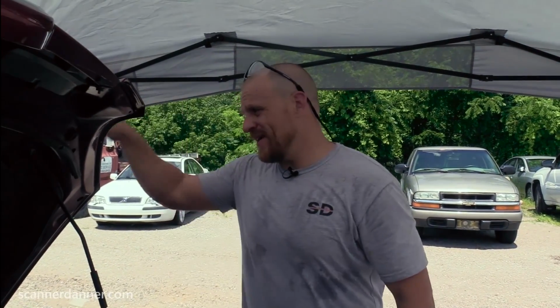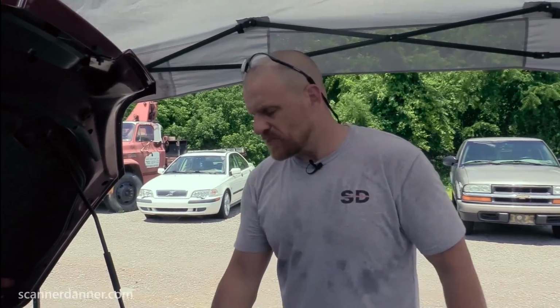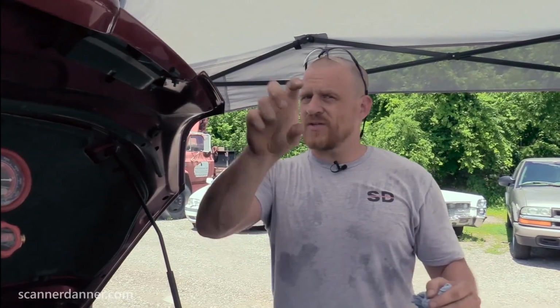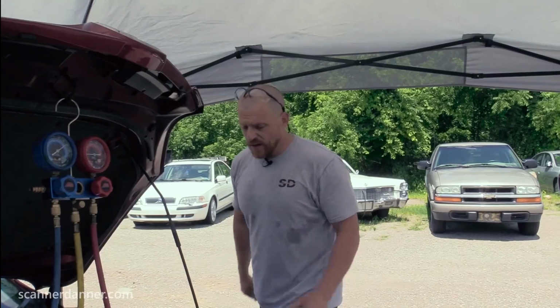All right, so what you missed, Caleb, is when I hit the AC button inside, it turned the LED light off, but never turned the control side of the relay off. Yeah. It was the blower switch, again, which is the same thing the scan tool showed us, reacted the same way. So in other words, the AC request signal stayed on until I turned the blower switch off. I'm not worried about that. I don't care that there's an issue with that, because here's the thing. The relay is being energized. We should have power to my clutch. My AC compressor should be turning on, okay?